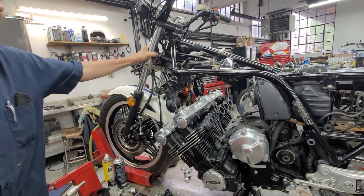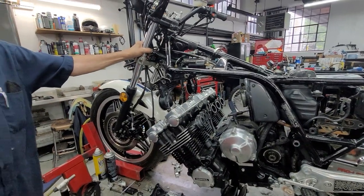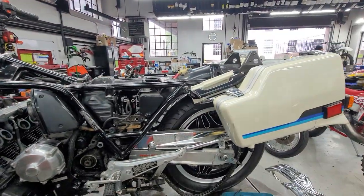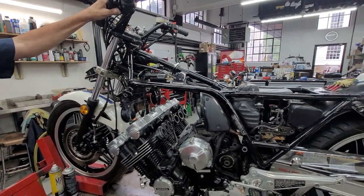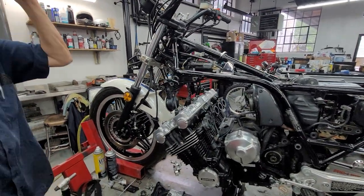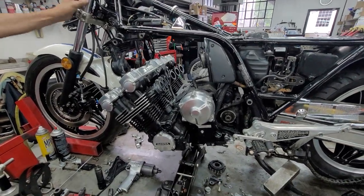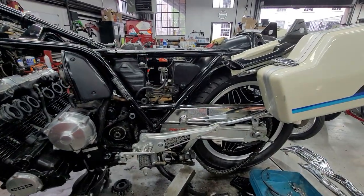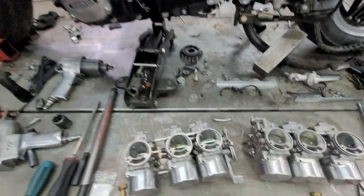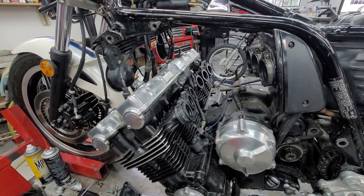If you could find a shop that could do this, expect 15- to 20-hour labor plus a couple bucks in O-rings — they might charge you $2,000 to do this, if you could find a shop to do it. So that's why when we buy these bikes — this was in a private museum, spotless when they came in — because they were stored improperly, it's a $2,000 setback. If you're buying a Craigslist or Facebook special that looks good but just needs a carb clean and there are six carbs, see if you find a shop that can do it.